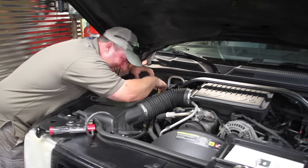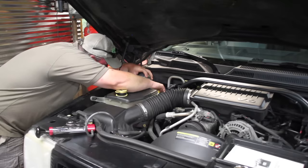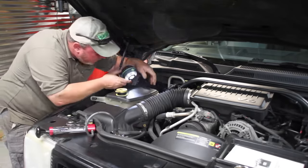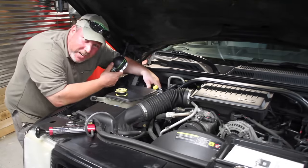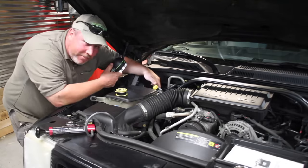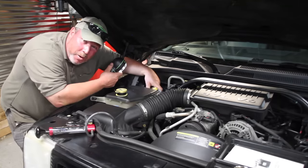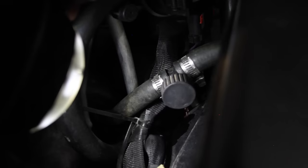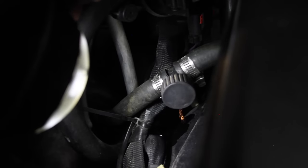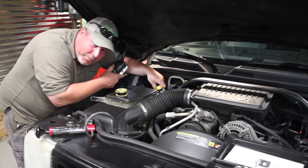Found it! That's it right there — it's leaking a lot. Some of you may recognize these: I'm not a huge fan of the radiator flush ports where you add these plastic port fittings. I understand the concept, but they're typically a cheap piece of plastic. Well, there are two of them here, and the second one is leaking like a sieve. It could be a loose hose clamp, but it's pouring out the bottom in a super steady stream.